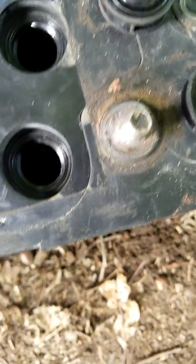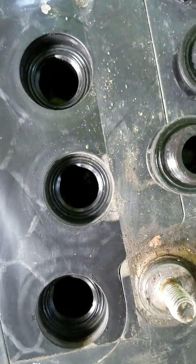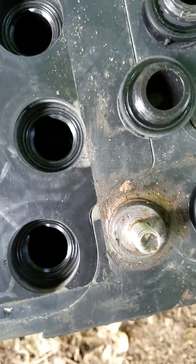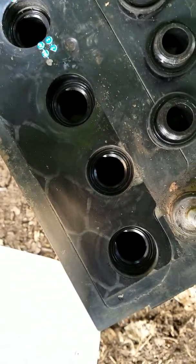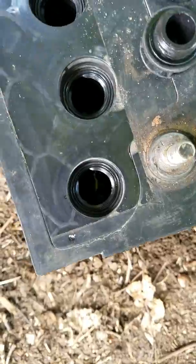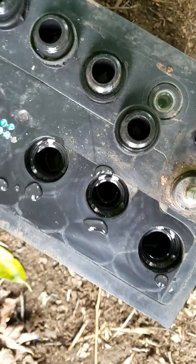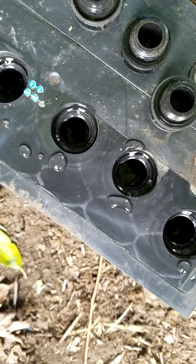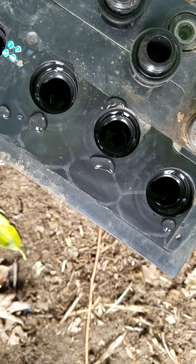There's a little slot in the tube that goes down — that's your vent, which lets gas out. You don't want to plug that off, otherwise you'll push electrolyte out of the battery and corrode everything in the box. These ones needed about a half inch of water and then they're full. They're now up to the bottom of the plastic cover plate, the vent holes are open, and they're pretty even, so they should charge evenly. These batteries are probably in pretty good shape. Now I'll get them on the charger and check the voltage.